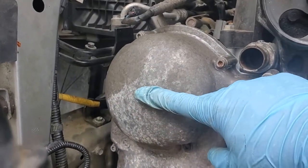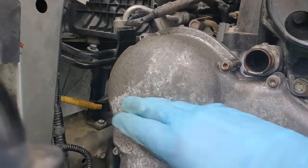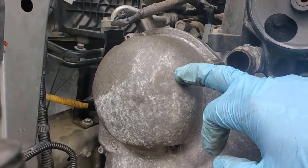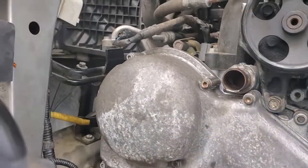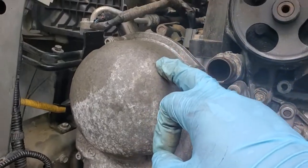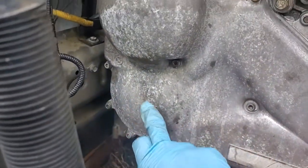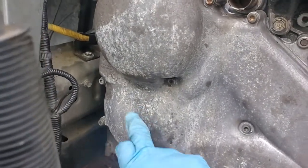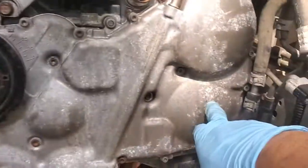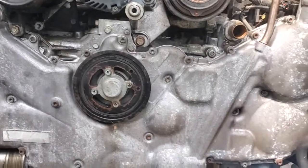This other one — which is the passenger side top, or intake — is 15 degrees up from horizontal. Same thing applies: on the chain you will see a little keyway that will line up with another one down here. If the keyway on this sprocket is facing up and the other one is facing up, your timing marks are perfect.